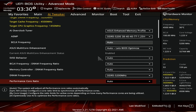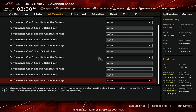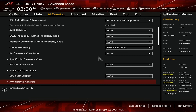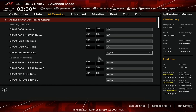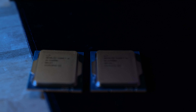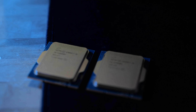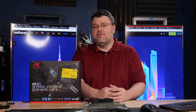In terms of other BIOS features, it's a pretty standard ASUS BIOS and everything is pretty much working as expected. Alder Lake performance cores, efficiency cores, all that stuff is here. If you disable your efficiency cores, you do get AVX-512 — the instruction set — if that's important to you. Mostly that won't matter unless you're already read in on those kinds of things. If you're trying to make a decision between an i5, i7, or i9, there's no gaming performance difference between the i7 and the i9, so you can save a couple hundred bucks and get the i7.